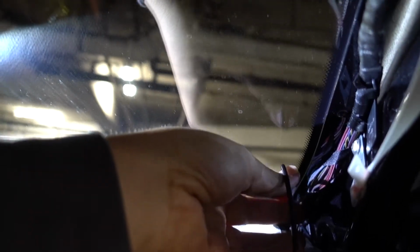Okay, so what you wanna do is start down here. I have the wire coming up from right here, going in through the glove box. I opened this part up so you could reach through it. And then I fished it out through here. Wires coming up right here, through here. And then you want to tie it off at the closest tie off point you can find. Probably tie one off right here, and then tie another one off probably about here with whatever strip or anything that you have. Tie one more off here.